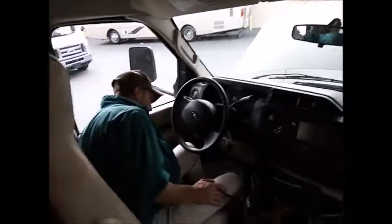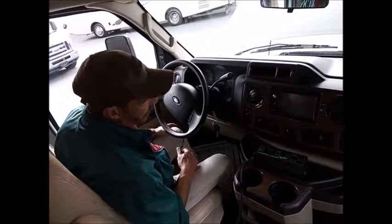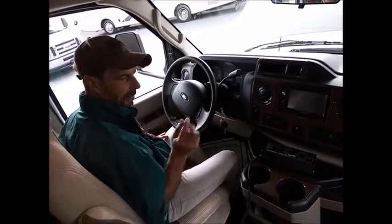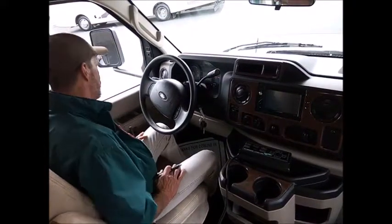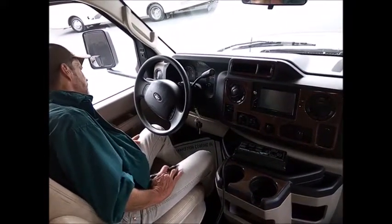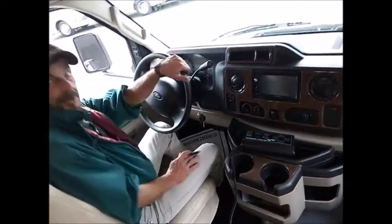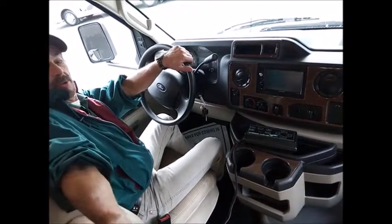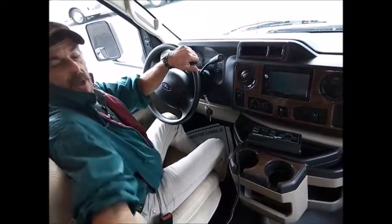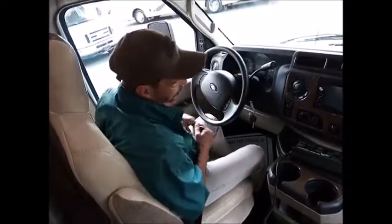Normally, I see an emergency start switch, which is like an automatic jumper cable to start the vehicle off of the coach batteries. But I don't see one on this coach. Some of them have them, some don't. But you could do it very easily, right? When you lift up that step, when we go outside, I'm going to do that control panel on the way out. That's where your batteries are.